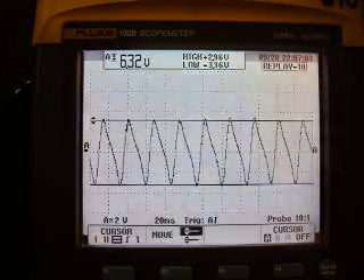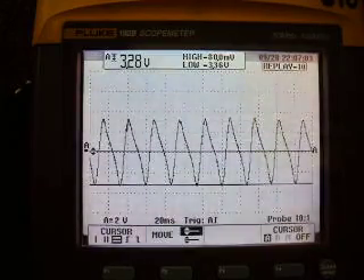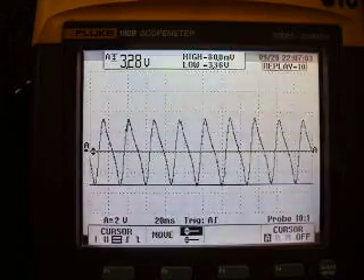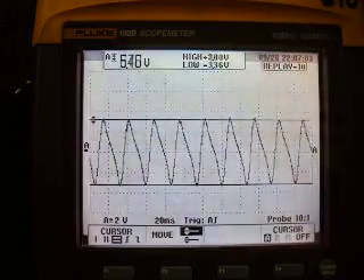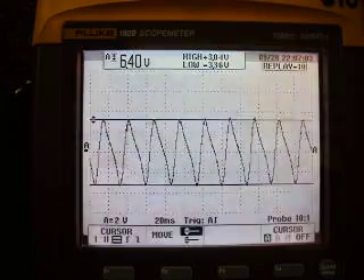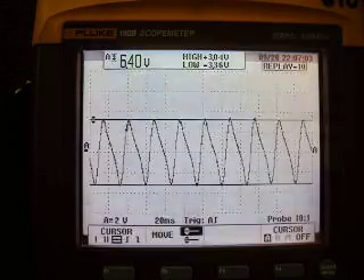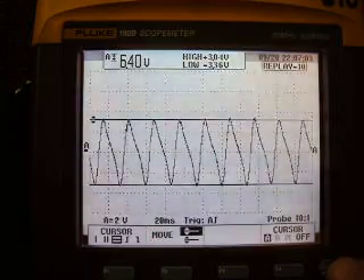It's always nice to see the pattern with the DSO. That's about what a digital meter is going to say when you have it on there, but it's nice to be able to see this pattern. I've had these before where they'd have glitches — a pattern that looks normal for a long time and then the engine would stumble — because this signal generator is not sending the right signal frequency to the processor to control spark. That's it for now; we'll have more videos later.